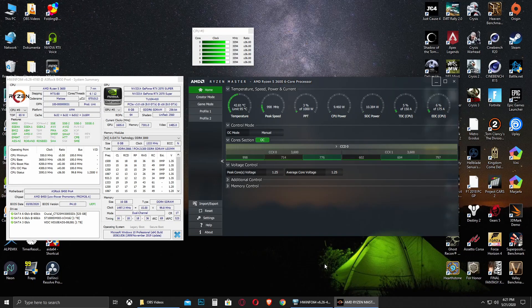Voltage is another very important factor when overclocking. On the positive side, voltage is going to give us more stable clocks and more room for overclocking. But on the negative side, more voltage is going to give us more temperature. So basically these two things are very much correlated to each other, and we are going to take a closer look at them when overclocking our CPU.